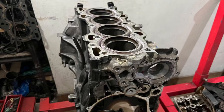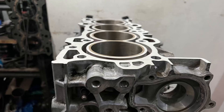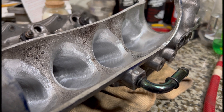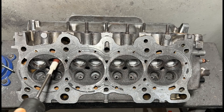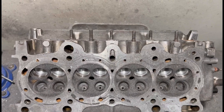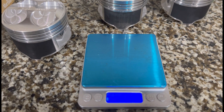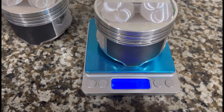On this episode, it's going to be all foam. We prepped the block and sent it and one of the pistons to the machine shop. Now it's all done — bored and honed, even decked. We started porting the intake manifold, finished up the P30, also made the intake gasket and port matched it. We started pocket porting the head, talked about the VTEC conversion for the B20 VTEC, and started balancing the pistons to make more power efficiently. Let's go.